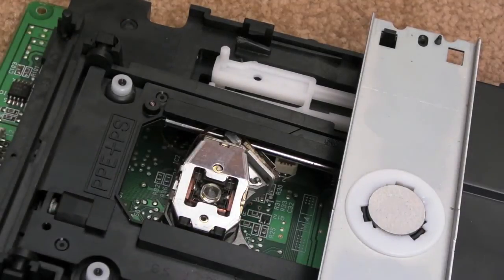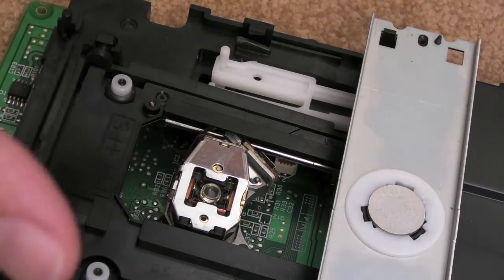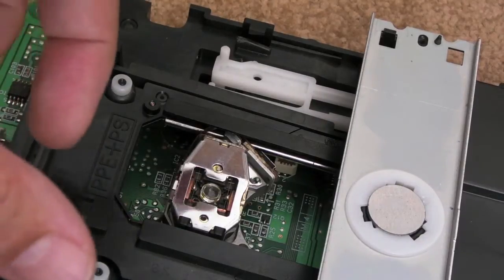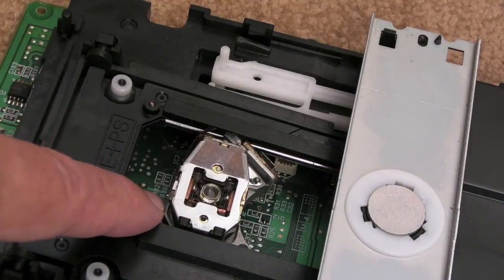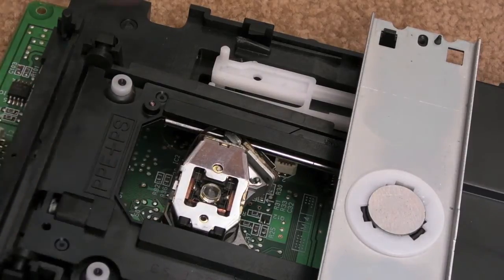What you need is an original pressed disc — start with a CD audio disc, because most of these systems are capable of CD audio. Start with a single pressed CD audio disc in good condition with no scratches. If you're still not getting it spinning, don't start playing with the voltage. The voltage is not going to be the issue, unless some muppet has adjusted the pot to some vastly inaccurate value.